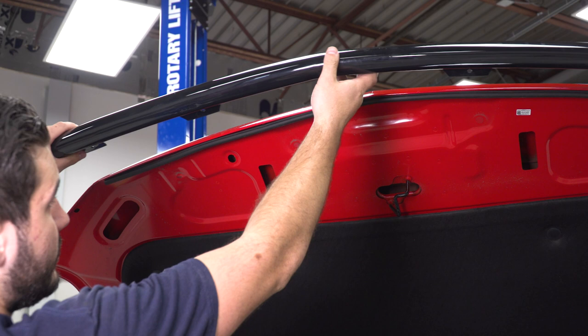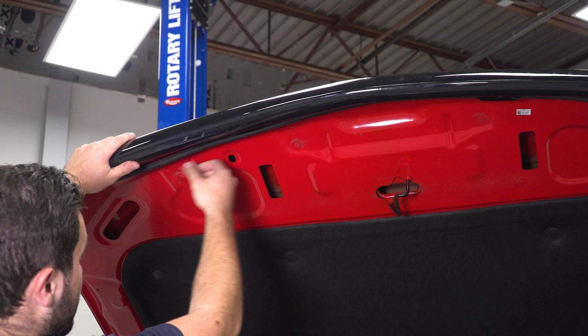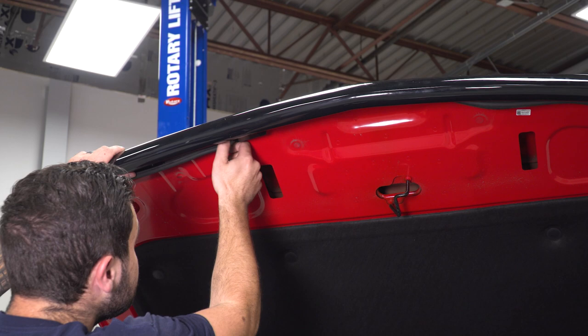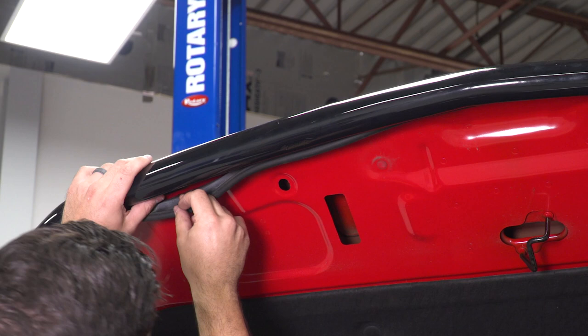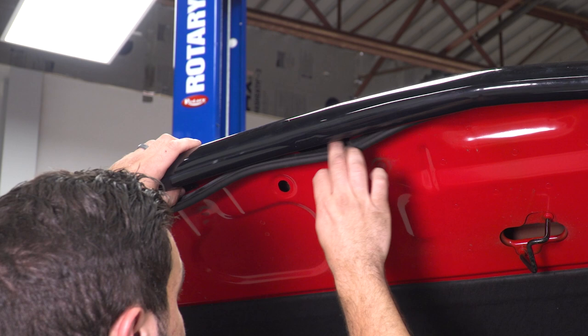This next step is a lot easier with a helping hand on the other side. Basically, you're gonna hold this up on the hood, pull that liner back just a tad where you removed the clips, and put these tabs underneath of that liner. Make sure both of them are going in simultaneously — be careful not to damage that liner. Do the same thing on both sides. Then take the plastic clips, peel back the liner, put it through the plastic tab on the hood deflector, and then into the hood where the factory clip was.